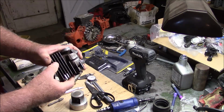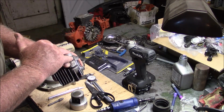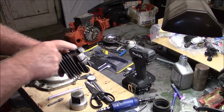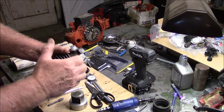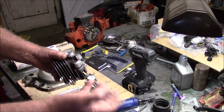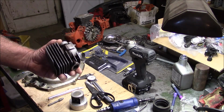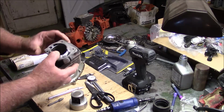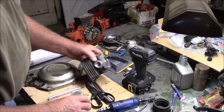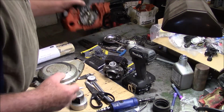And there's two things that happen there. I talked about it just a little bit in the video. One is, by reducing that thickness, you also reduce the strength. And I can tell you, I've repaired saws where there was a big reduction in this thickness, big increase in compression that corresponds to that. And these damn things flex. You'll see them actually flex down. So that's one. And the second thing that happens when you lower the transfer is when the piston's at bottom dead center. I was trying to explain that in the video.